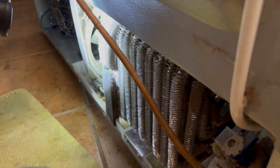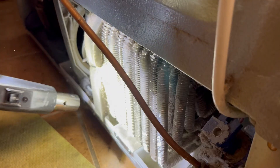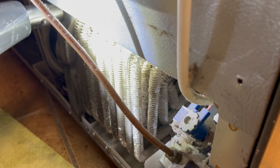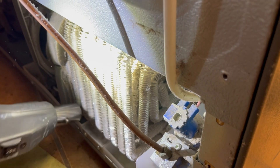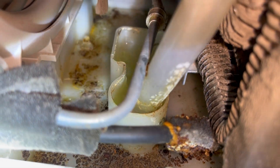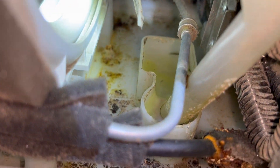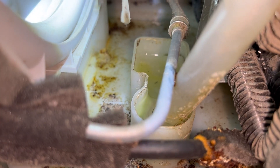Whenever you do this, you ought to check the pan — it's a small pan to the left of the coils. There's also a plastic tube; you can check those things and make sure that tube is cleaned out. That might have been what the issue was last time, along with the blocked vents in the freezer. You have to make sure you have that even cycle of airflow. Here's the pan and the plastic tube — they look dry, and the fan rotates, so it's still working. Be careful not to get that drawer too full or you'll have trouble.